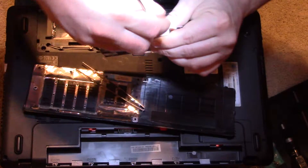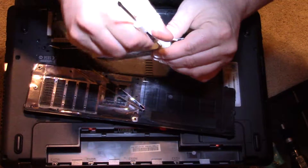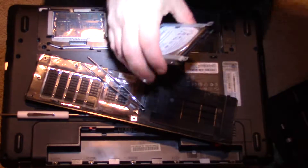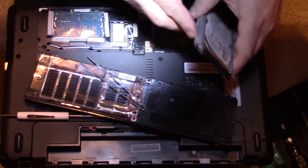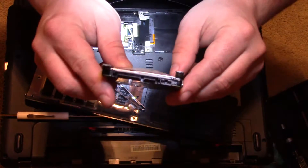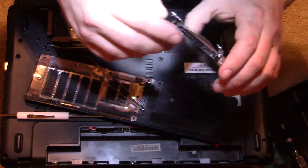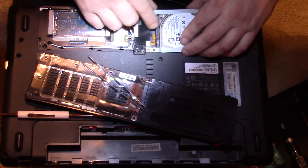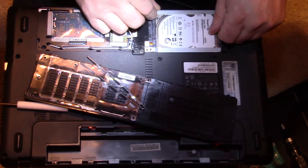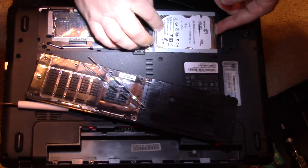If you're not good with computers, you can do this — I promise. Just take it slow, be careful, watch what you're doing. That's complete. In this case there are no screws to put in for the drive bay, so you just slide it back in. It's going to have two ports — a data and a power port. You just slide this in exactly the way the other one came out. You can grab the tab to help you line it up, but just don't force anything and make sure you push it all the way in so it has good contact.